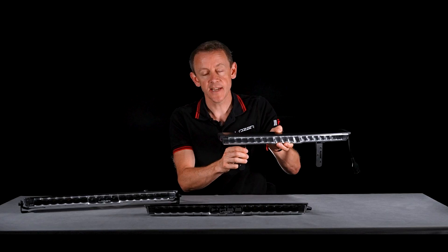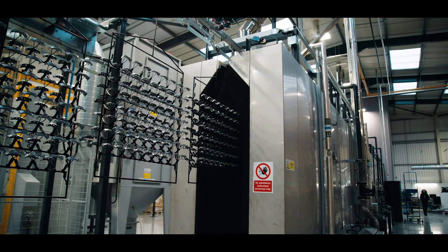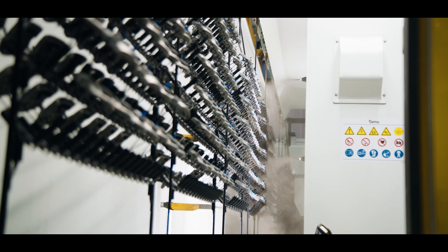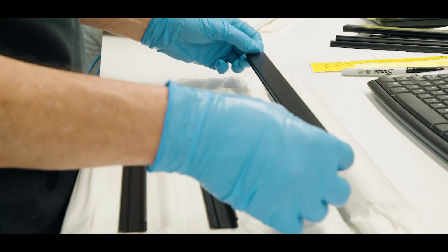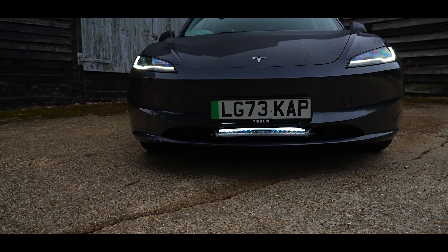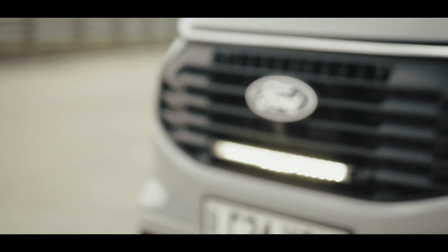All brackets are stainless steel and are powder coated in-house to ensure maximum corrosion protection. The heatsink itself is also coated in-house at our UK manufacturing plant before final assembly, going through the most rigorous test standards. It is marine grade aluminium and fits very well into the lower grille opening or wheel opening of many passenger cars, and it's also compatible with our grille kits originally designed for Linear.